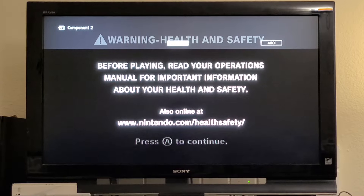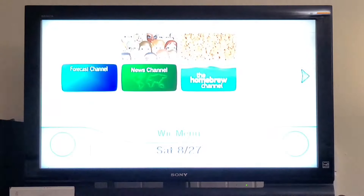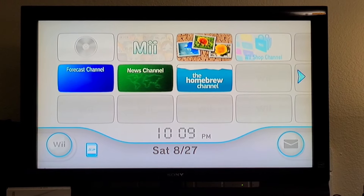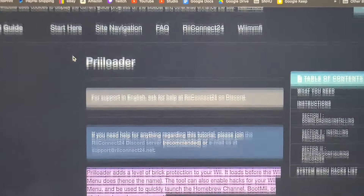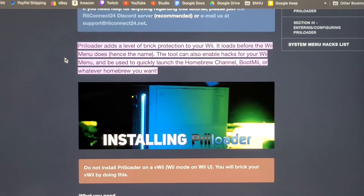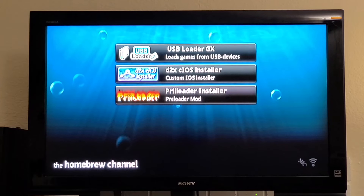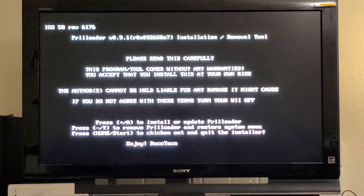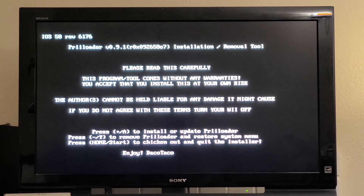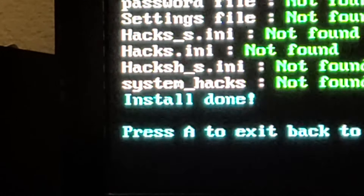However, there's a current issue — not all Wiis have this but some do. Some of them you can install a program called BootMii that goes right to the Homebrew Channel, but this one doesn't support it and it kicks us to the Wii menu. That's not going to be useful on a Wii shoved into a GameCube shell, because you're probably going to be using a GameCube controller. So the idea is to install something called Preloader — it's going to let you auto-boot the Homebrew Channel, which does work with a GameCube controller. We have the Preloader installer ready to go. I pressed one button and it says 'install done,' so I guess that was pretty easy.